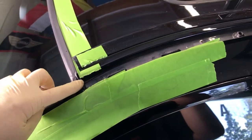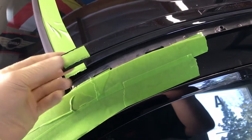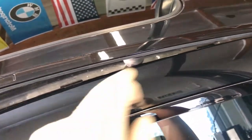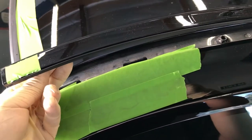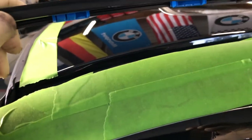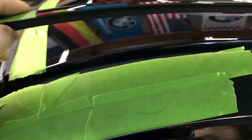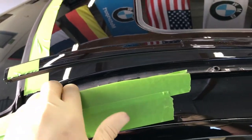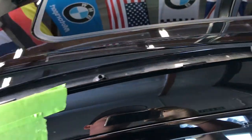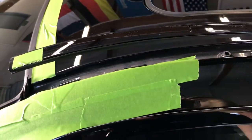You can basically just get something like a plastic little wedge tool and pry this tip up — it'll pop straight up here. You can see I propped it in the back with a little rubber bushing. Now there are some clips that hold these on; they're likely to break. You're going to want to order those beforehand — they just clip in and slide in. Sometimes they're one piece only, sometimes you can reuse them depending on how old or worn they are. In this case, I'm going to have to replace probably three or four of them.